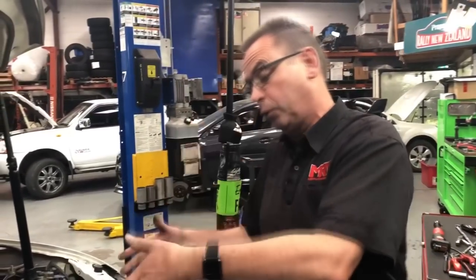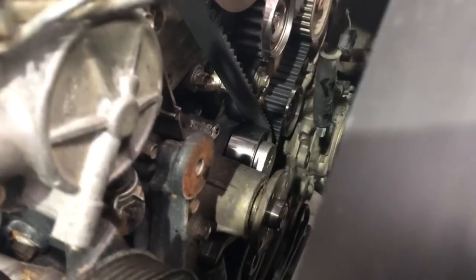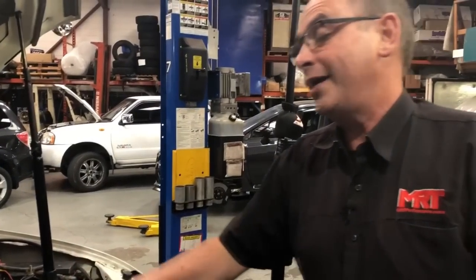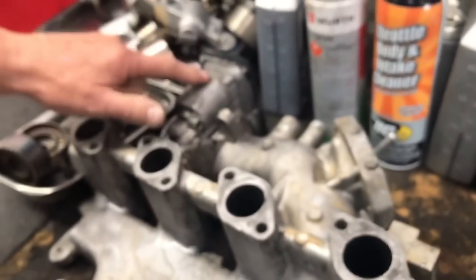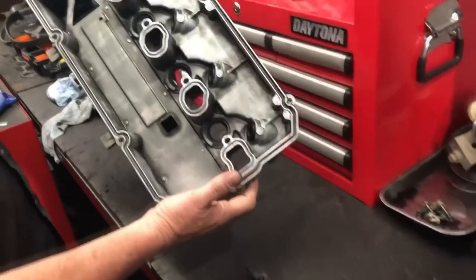You can see now we've actually put it all back together. Comparing to the photos we originally had in the video, it's now got a brand new belt, and also down the bottom it's got all brand new pulleys and idlers, and the balance shaft belt tensioners and everything fitted back correctly. We also had to do a soot clean on the engine, which we diagnosed as quite dirty. This is the inlet manifold we've now removed and already cleaned, along with the electronic throttle body over here.